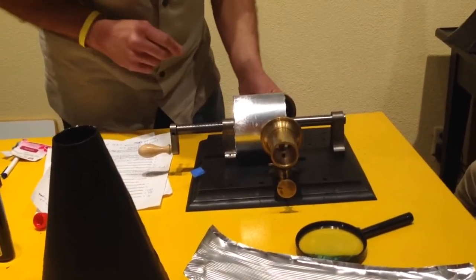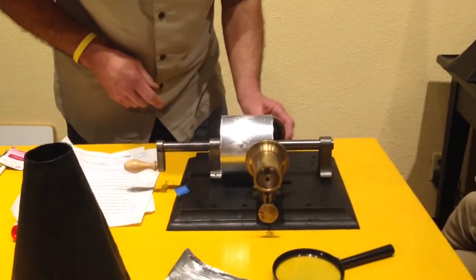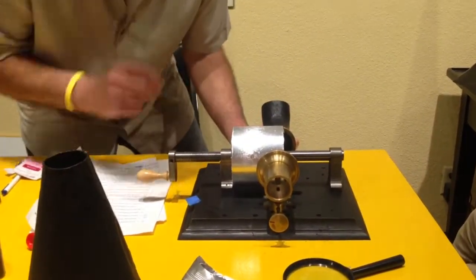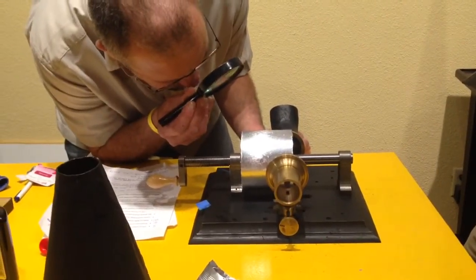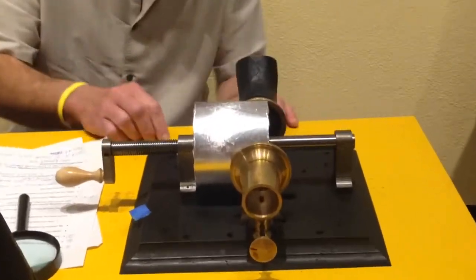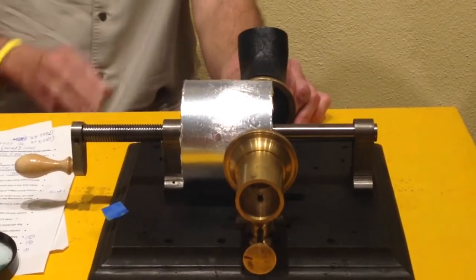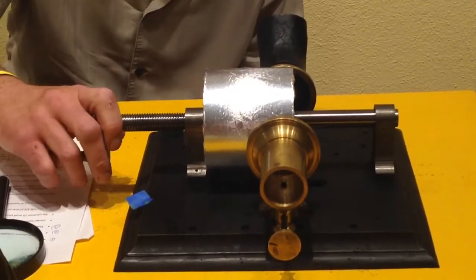Now I'm going to dial in the recording — the needle's close to the foil. There's a little line, a mark on there, so I'm going to turn this up. I've got it adjusted just right so that when I get this to the 12 o'clock position, you should just be able to hear a little scratchy sound in there.